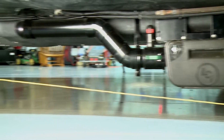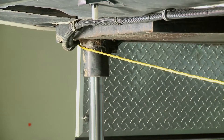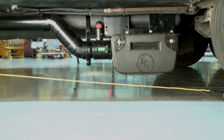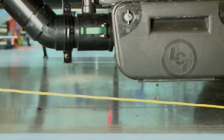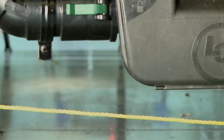There's another aspect to the storage box ground clearance. Doug says that if you draw a line from the bottom of the front tire to the top of the front jack on the underside of the trailer, nothing should be below that line to avoid the possibility of it getting hit on uneven ground. You can see here that even though the storage box looks quite low, it's still above our line by about three and a half inches.